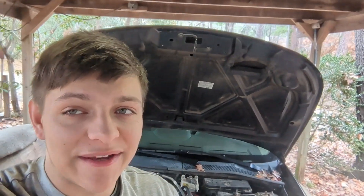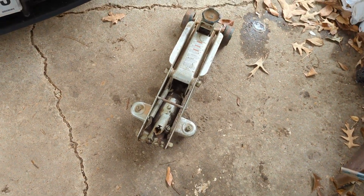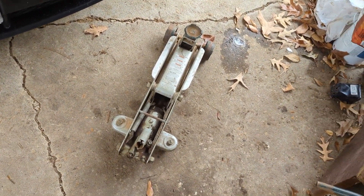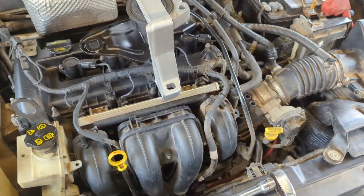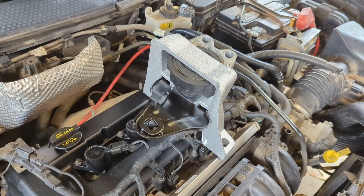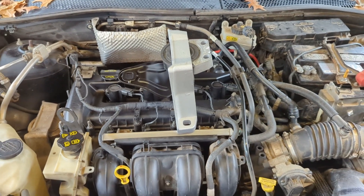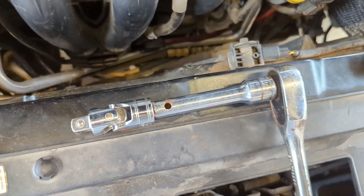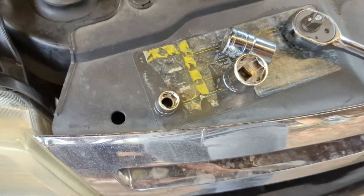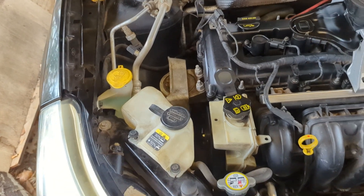So I bought a new part, and today I'm going to install it and show all of you how to do the same. Installing the new engine mount is so easy — you only need a handful of tools. Most importantly, you'll need a floor jack or scissor jack, something you can use to get under the engine and support it so that once you take out this motor mount, the engine isn't off-balance and putting all of its strain to one side. You'll also need the new engine mount itself — I'll put a link below where you can find some on Amazon; you can get the whole set of three for around $60. You'll also need sockets: a 10 millimeter, a 16 millimeter, and an 18 millimeter to get all the bolts off the mount.